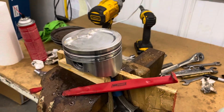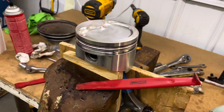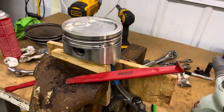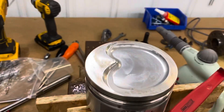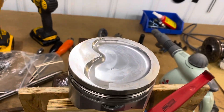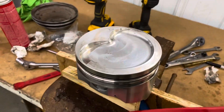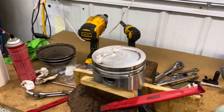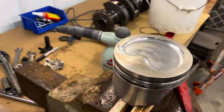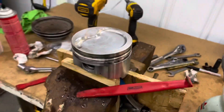With a little bit of elbow grease — I did use these cheap nylon trim tools to do a little bit of scraping, and a very little brake cleaner to dissolve some of that — the steam took care of most of it pretty good. Of course we'll have to detail the ring lands and give them a good final clean before we assemble, but we're a ways from assembling, so we'll go through it one more time. Pretty happy with how quickly these are cleaning up.